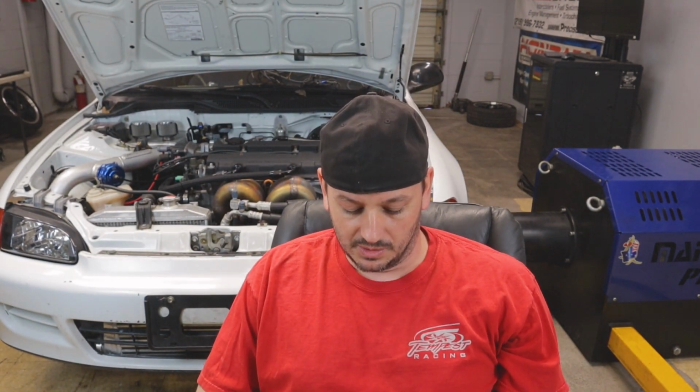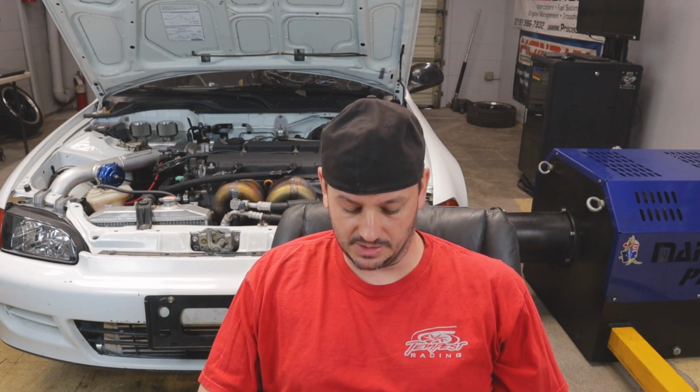Why are the runs so long or so short? I guess it depends on what you're used to. There's some situations where maybe some things are a little questionable on the car, so you're trying to speed the ramp rate up just to keep it alive. Some of the lower horsepower cars, especially some of the road race cars, where they're running 5th gear full throttle for extended periods of time, sometimes I'll make the ramp rates really slow and drag the run out. There's also some step tests that you can do. I don't think I've posted any videos of that, so I'll do that as well.